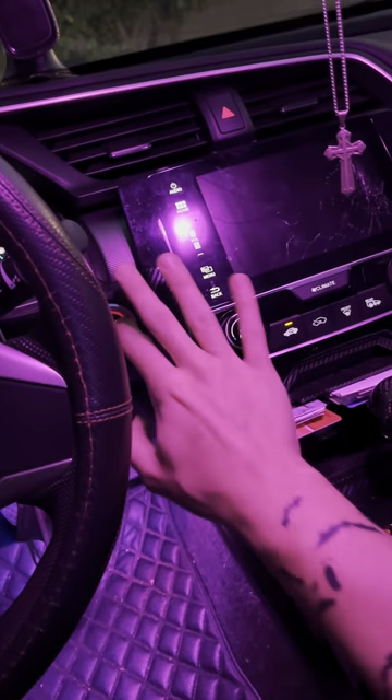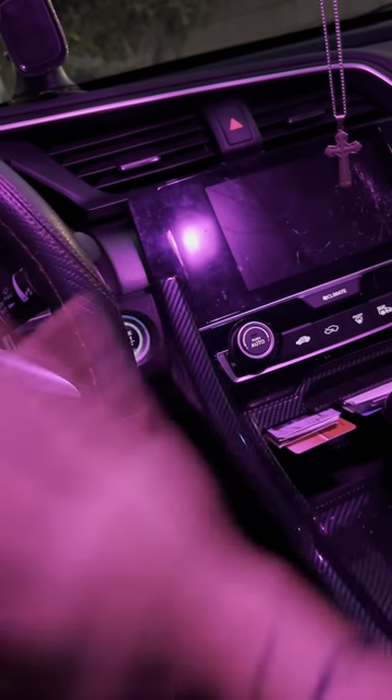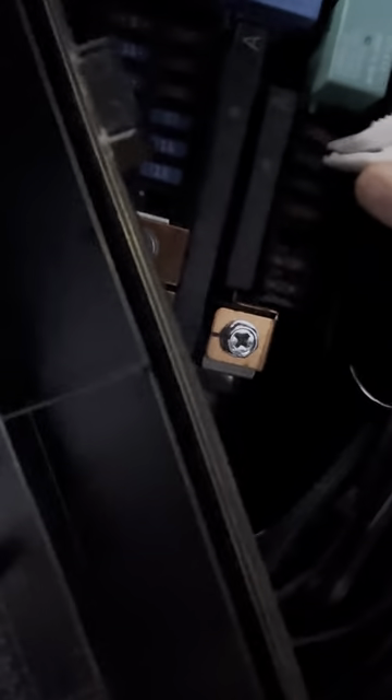To start, make sure your car is off — no power at all. Pop the hood, get under here, find your fuse box, and take the fuse puller. You're going to remove the one that says audio. If you turn your car on without this in, the audio will be unpowered entirely. That's a 15A fuse. Take it out and leave it aside.